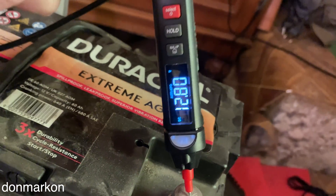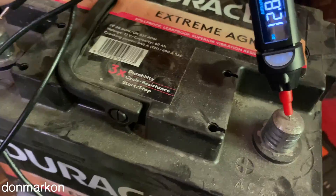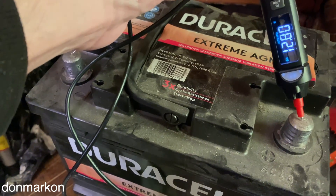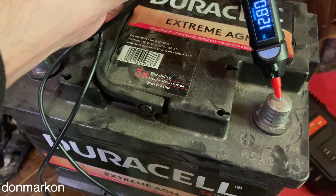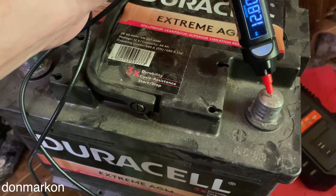One week later, I have the battery disconnected from the charger. I wanted to see the resting voltage — it is 12.8 volts, which is quite impressive. Keep in mind that this battery was nearly brand new, but in my friend's car there is a problem with rapid discharge of the battery.